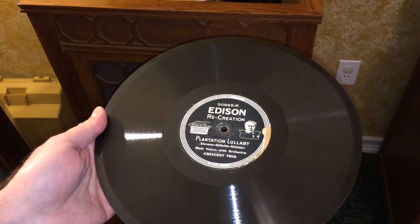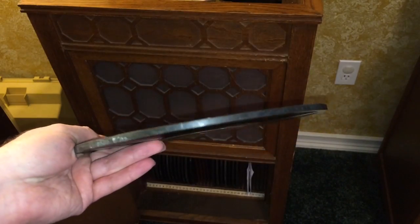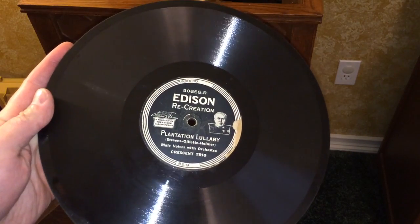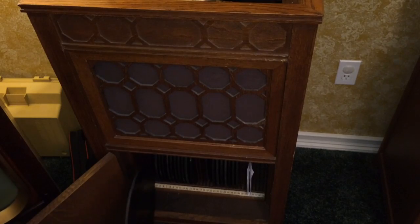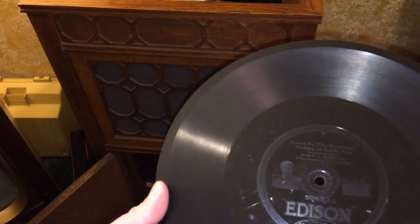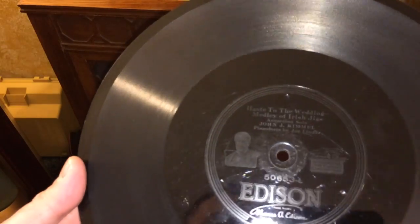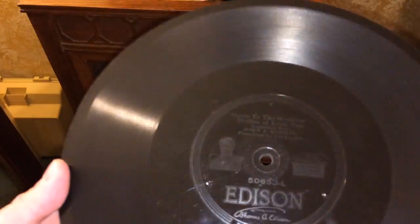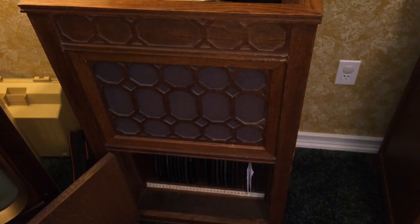Don't play 45s, LPs, or anything else on it, because it will destroy them and may in fact ruin the machine. Thickness of record and Edison on the label — those are what you look for. Sometimes paper labels fall off and you may find one without a label; that's very common. Another record type you may find has three little indentations where the label is actually stamped or indented onto the disk itself. By turning it a certain way in the light you can read what's on the disk — it almost looks holographic — and there is a picture of Thomas Edison on the left side. Only use records that have Edison's name on the label.